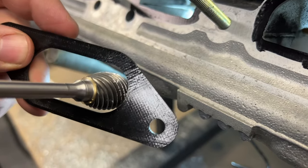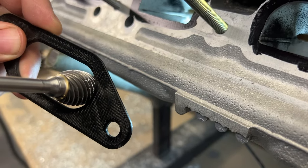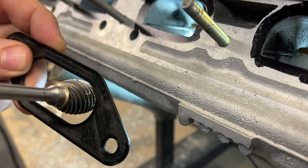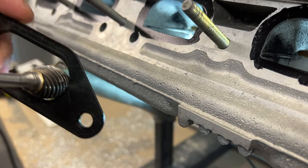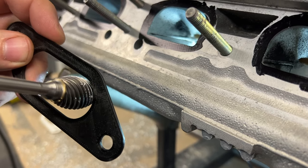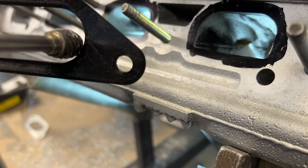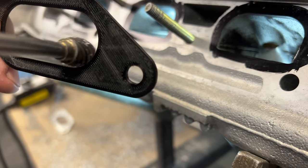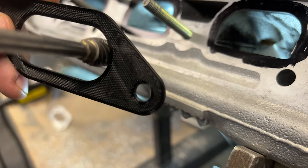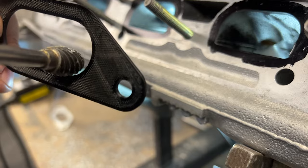I just want to show you guys something here. You see how this radius looks a lot like the burr, and this is why I chose this burr. When you're doing this kind of stuff, it's taking out a lot of meat, but you really want to use something that makes your life easier. That would be to start with a burr that has almost the same shape and takes material out very quickly. Instead of you trying to make that radius, you pretty much have it. Now, if I show you the half inch burr, this is what I'm talking about. Sorry, it's a little hard to see, but you have to keep making that shape. There's a lot more to go wrong, because if you use something small, now you're trying to shape it. Whereas the other one pretty much took up this entire circumference and the radius was exactly the same. And it's way easier to shape it with something bigger.